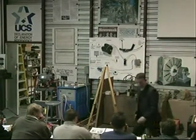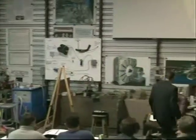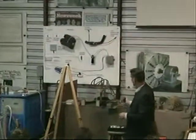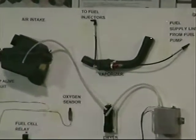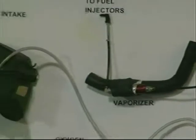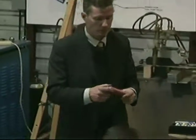Heating the fuel, page 14. We have, as part of the kit, something we call a vaporizer. You can see the vaporizer in this illustration is strapped to the upper radiator hose. Heater hoses would be better. If you could take your heater hoses and get this between the two, for one, you're going to start getting heat to this before the thermostat opens. Your thermostat has to open before that starts working. Heater hoses, as quick as the engine builds it, you're getting it, all right?